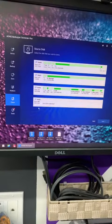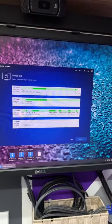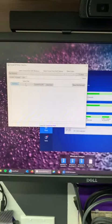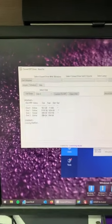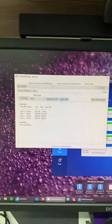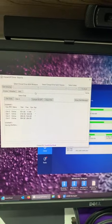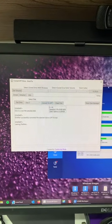I'm going to be cloning their hard drive onto the new one. I'm going to have to repartition it first. To do that, I pull up the Disk Manager tool. Go into Extras, Get Disks — it'll list all the hard drives. I know it's going to be disk number three, the one that's almost a terabyte. I'm going to clean it, just erase it. Yes, I want to erase it. I'm going to convert it to GPT. Converted.